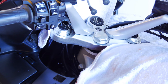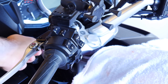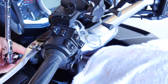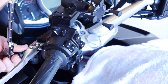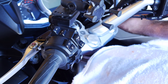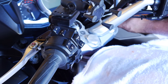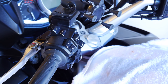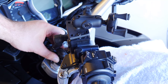Now tighten down the fork pinch bolts — these go down to 19 foot-pounds; basically a little bit more than your average spark plug. If you have an A model, skip the next step. If you've got the ES, reattach your suspension controllers — they just slide on — and pop your boots back over, and you're done.